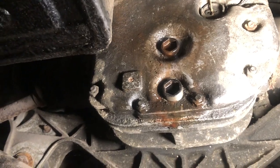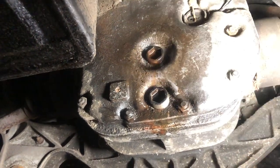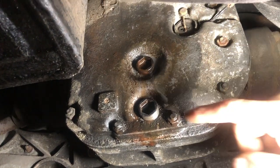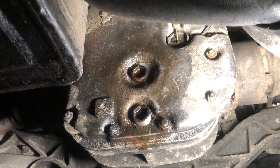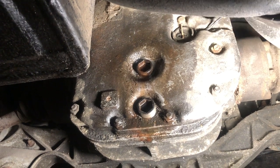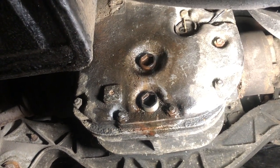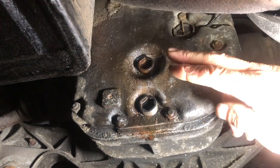In every write-up you see people say: always make sure the fill plug comes out before you take the drain plug out. Well, I didn't have a socket set that would fit in here so I went ahead and took the drain plug out — and of course my fill plug didn't want to come out. I've got it loose luckily. Bear in mind the fuel tank is right next to me — I'm that confident my fuel tank is secure and not leaking that I put a bit of heat on this, heated it up with a lot of penetrating fluid, and after about 10 minutes it's just started to undo. Happy to report the fill plug is coming out.